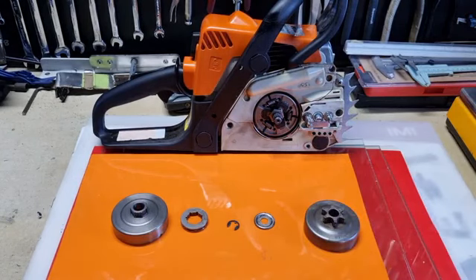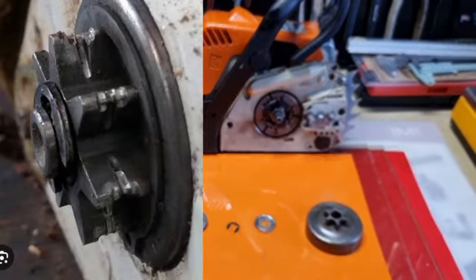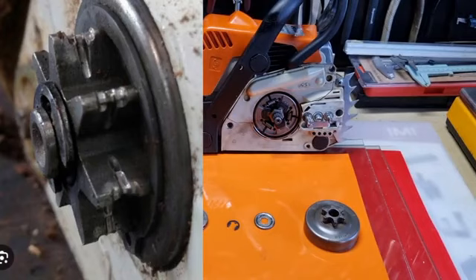That's quite serviceable. But I think that their quarter or half a millimetre wear guideline is quite conservative. And if you look in the top left hand corner, this is an excessively worn spur sprocket — obviously you would never let it get that bad. For me, I'd let it get to about a millimetre, then I'll change it out.